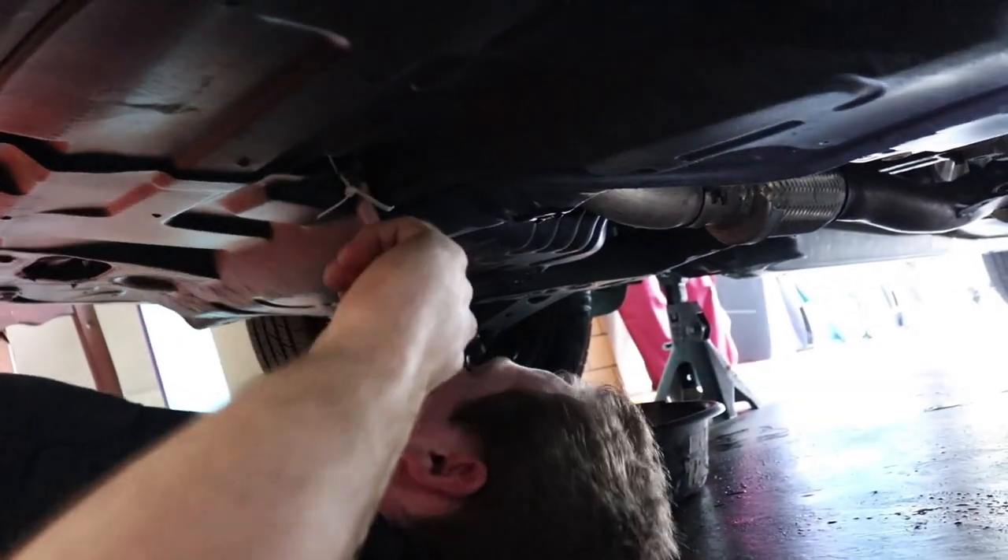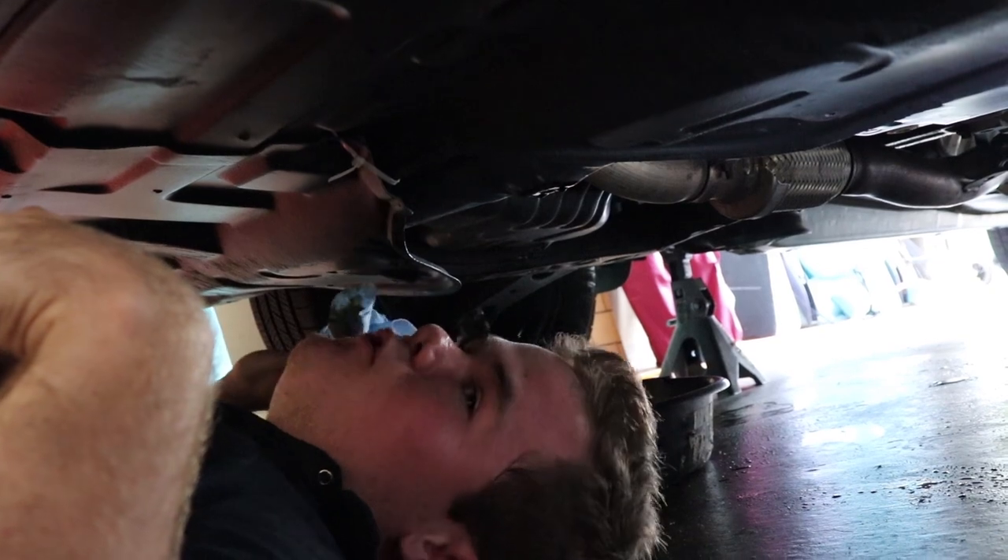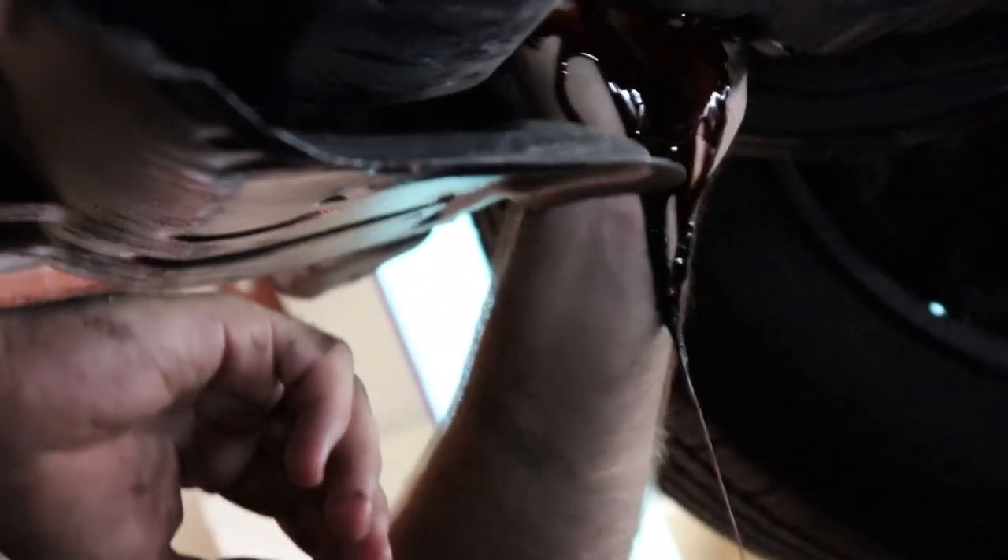After that, you have to come up into the front of the engine and you'll find your oil filter. Sometimes it's too tight to get off and you'll have to take a tool like this to pull it off. But my filter is not on there too tight, so I can just pull it off by hand. Make sure your pan is under the filter so that you catch the oil and it doesn't flood the garage or wherever you're working.